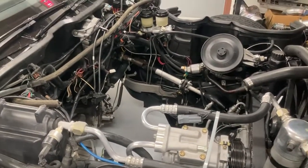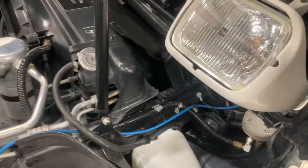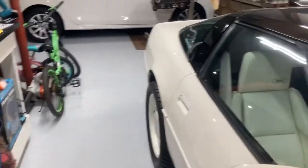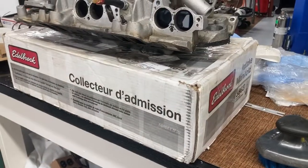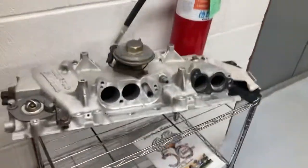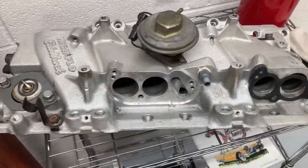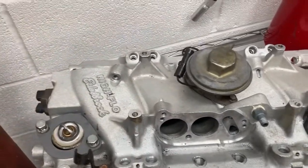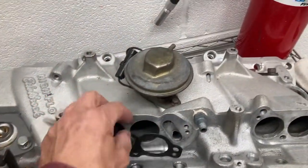That FMU is adjustable. At around 42 to 45 PSI fuel pressure it's squirting a lot of gas, but it's not a modern way of doing it — it's old school — and it does work. But this time we're going back with a complete set of Edelbrock big tube runners and the big tube base — there it is right here. I'll put my EGR on it, but the big tube runners are new, basically hardly been used. They were set up to bolt on the car but never were. They have bigger ports in them and that'll help a little bit.